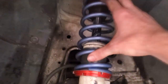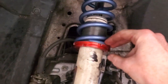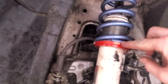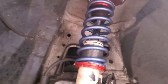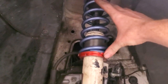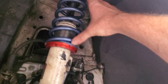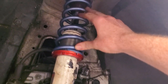The goal is to have pretty much just a tiny bit of spring tension on here. A lot of Asian manufacturers of coilovers have separate adjustable shock bodies which dictate the length of the car, and the spring perch is just for spring preload — you want just a tiny bit of tension so the springs don't rattle at full droop. In my case, due to the way these TC Klein coilover shock bodies are made, I've gone for the tallest possible spring that this spring perch can accept, which is an 8-inch tall spring. The only way I can raise the car is to lift the spring perch up and bind the spring, reducing travel and ride comfort, which is not ideal.